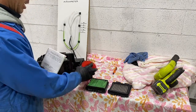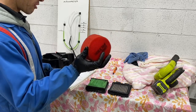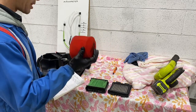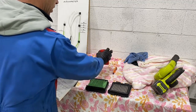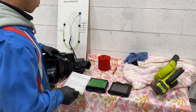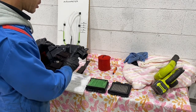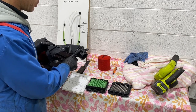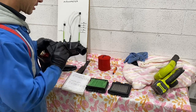The results are the 100 mil Unifilter intake is a winner. It added no restriction with the 4-inch intake. It added no restriction to the actual flow test. The actual biggest flow result was taking out the standard CRF300 intake boot and putting the CB300 intake boot on. It's a modification, but it is well worth doing it. The difference is huge.